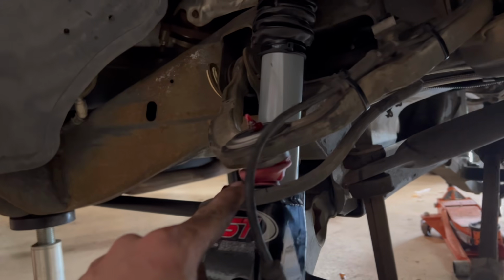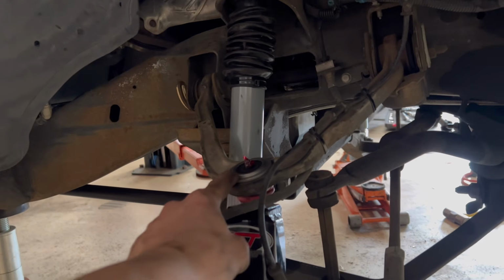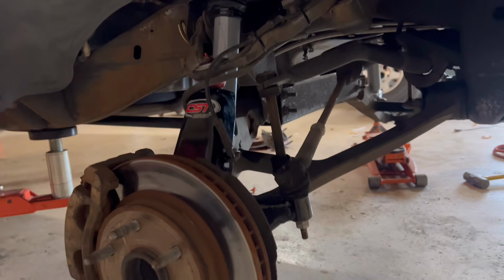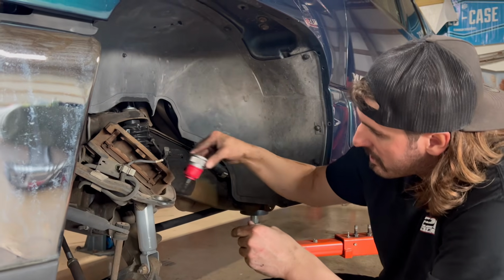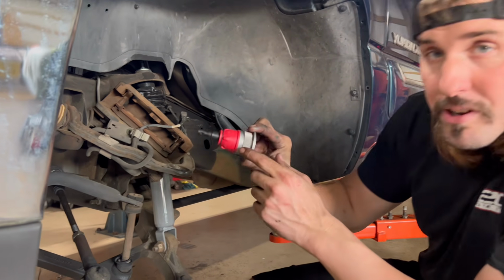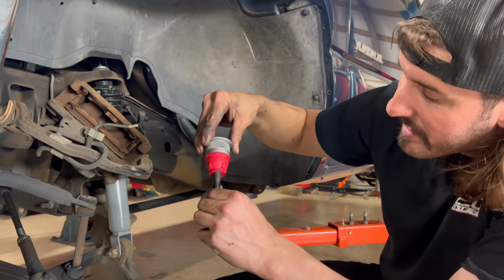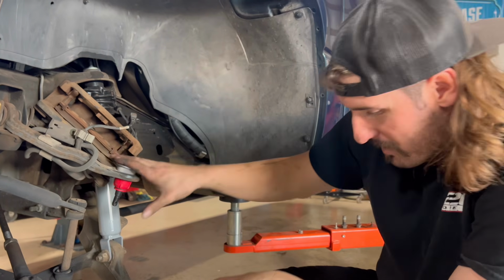I did do ball joints while I was here, at least uppers. I got the Dorman heavy duty fleet uppers. Take a gander, yeah. Let me go ahead and start the driver's side right quick. Let me go ahead and press that in. The new one even uses a snap ring, y'all. And they got little splines on that grip. Just overall a better heavy duty ball joint. Let me go ahead and press it.